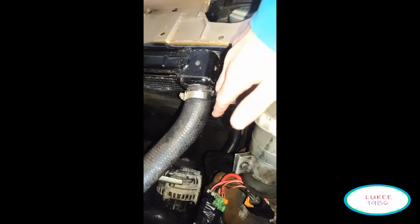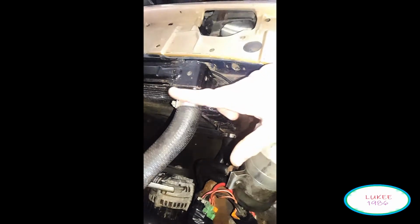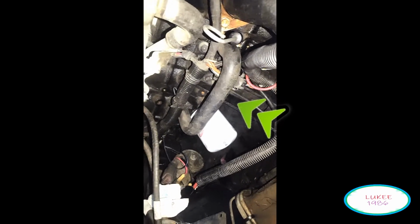So yeah, just going over the top hoses and the bottom hoses of the radiator. Just unhook the bottom one and the top one and flush it from the bottom hose out. That's the top hose, just in case you didn't have it connected and wanted to know where it goes, and the bottom hose. That middle hose, I'll try and put some arrows up in the video if I can remember my special effects. We've got these two hoses at the back, and there is the vac line in the middle of it that I'll show you later. And there's the hoses that run up to the heater, and where they go, hopefully you can see that.